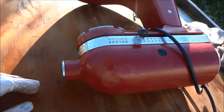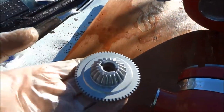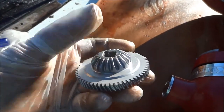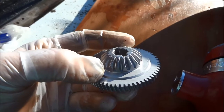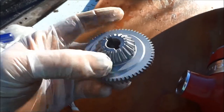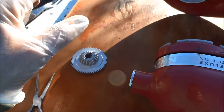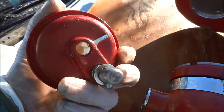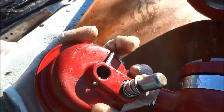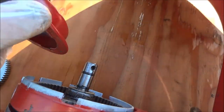We're going to take it apart and put this gear in. Some of these will actually have two gears — a top gear separated from a bottom gear — but this one is a solid one-piece gear. The first thing to do is take this bottom mixer arm attachment part off. You can see there's a pin in between here that has to be pushed out in order to take it off the shaft.